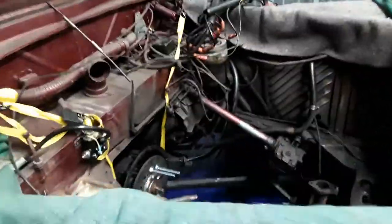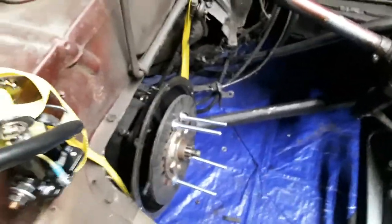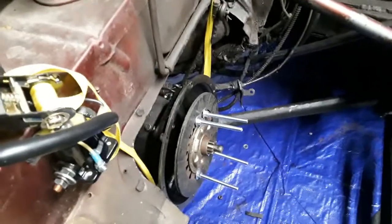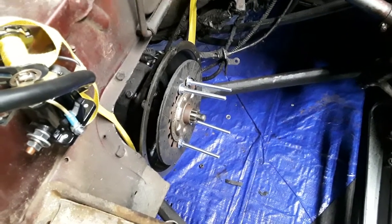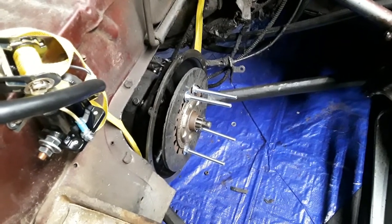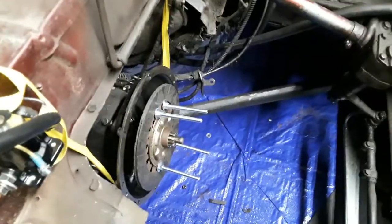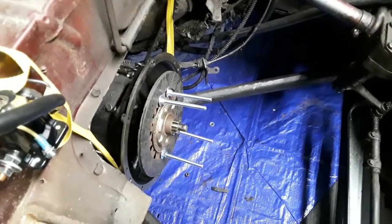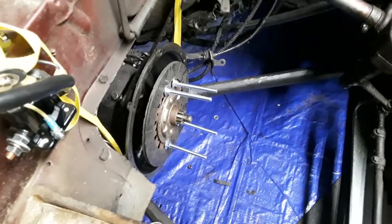You can see down in here I have this clutch disc set up on the transmission, because this car had a problem inside the drivetrain. I couldn't pinpoint the problem, but when you put the car in gear with it running and go to lift up on the clutch, you could actually feel something in the drivetrain taking up slack — you could feel it take up slack, then it would bang, and then it would start moving.